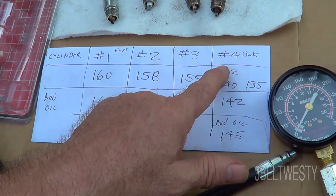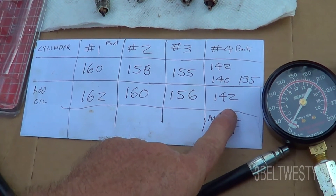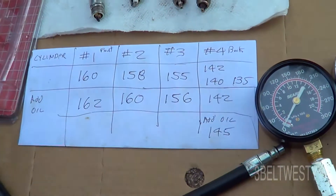Tell me what you think — this could be a small crack or defect, the valve not seating, or it could be that the cylinder head gasket isn't sealed as well in the back. The engine kind of drops going toward the rear.